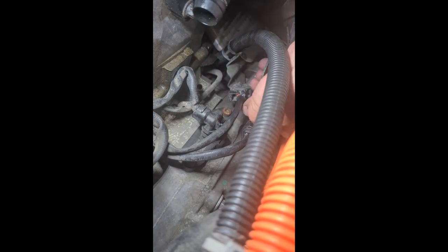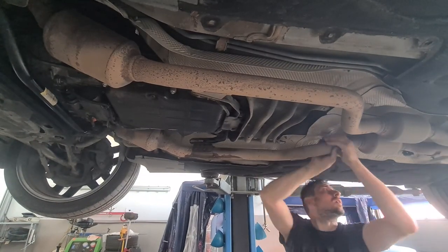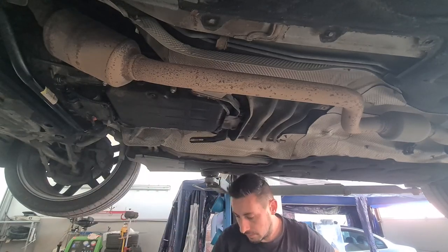I had to lower the car down to unplug the wiring from the O2 sensors that are installed on the pipe. It's not a comfortable position as you need to bend over inside the engine bay to reach up for them. The connections are right behind the engine just over the transmission. Removing the harness from the bracket was more difficult than the unplugging. Now this section of the exhaust pipe is free and just needs to be taken off.